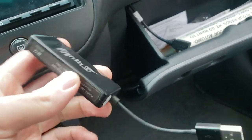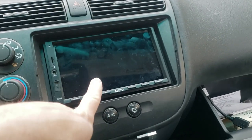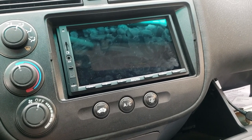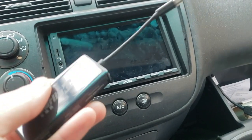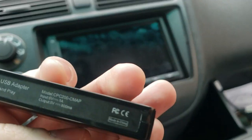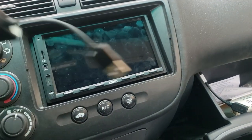I'm going to hook up my phone and show you how this works. I don't really recommend this radio — after using it, it's pretty slow. With CarPlay running it's perfectly fine and runs absolutely great, but otherwise it's a little slow. It's tedious to turn on your phone's hotspot all the time to get Spotify and Maps working. I recommend the CarPlay adapter — I'll put a link in the description. The reviews aren't great but there aren't many options and I've had zero problems. The seller said 1.5 amp charge rate but it actually outputs 800 milliamps, so it won't charge your phone much — maybe just maintain your percentage while using CarPlay.